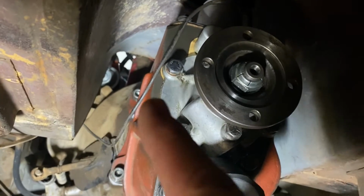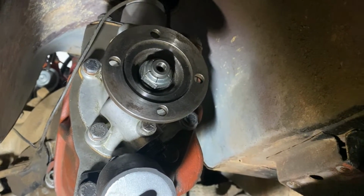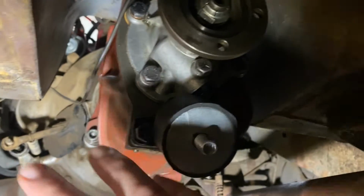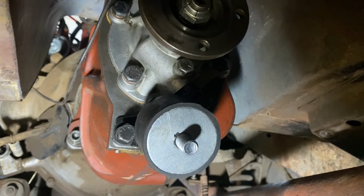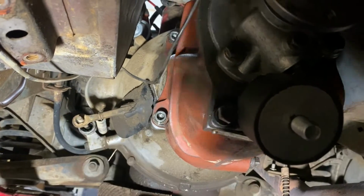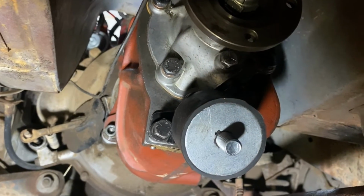And you can see there's new seals around there. We've got the output shaft properly torqued. We got it up on the bell housing. That was pretty easy. Just put it up on your belly and lift. It goes pretty well. Yeah, I've got to replace some rubber bits over there. I have them. Not going to do it today. We'll save that for another day.